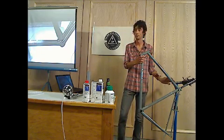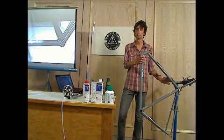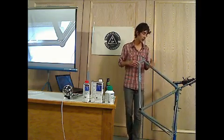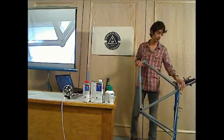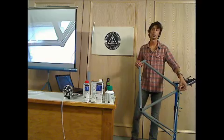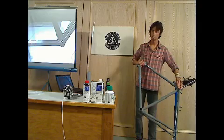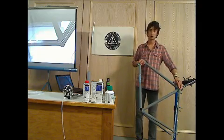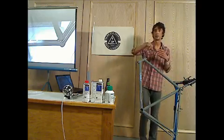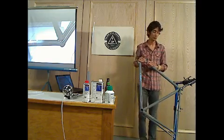So like those plugs on the seat stays, if they're extremely highly polished, then your masking doesn't have to be high detail because nothing is going to stick there anyway. Well, you want to be right on, because nothing will stick to this, but it's going to stick to everything around it. I put the mask on before I blast the bike, a little oval shaped sticker. I put that sticker down, then take it to the sandblaster, so everything right outside of it gets blasted and you have that edge. Okay, so you want that nice clean edge.